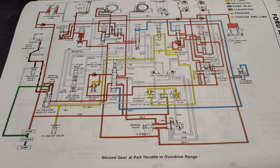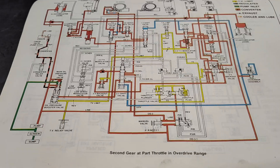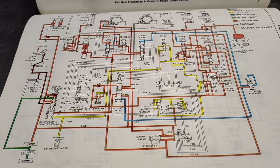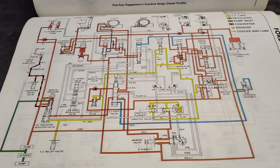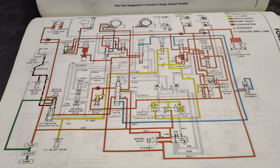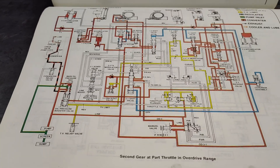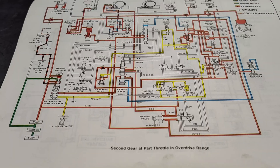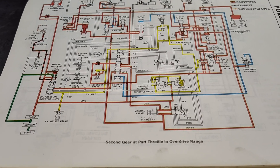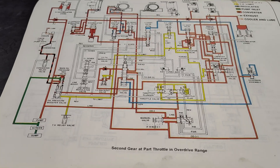Some knucklehead's not going to install this and not hook up the TV, go for a ride and nail it, and burn the thing up in three blocks. The customer will always argue, 'Oh, I barely drove it, just around the block.' Well, it can burn up. If you don't understand this stuff, you can burn up a transmission really quickly. I don't care if you only put five miles on it or five blocks — you can still hurt it. You can hurt it before you even put it in gear. If you don't stab the converter correctly and check clearances, there are just so many things that can go wrong on installation that are not the builder's fault.